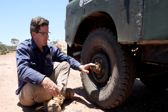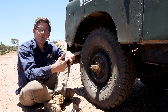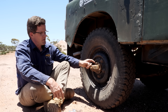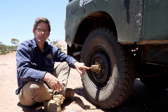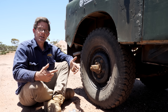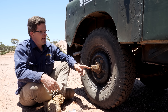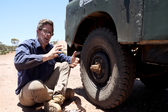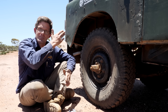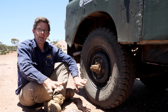So it allows that. Now, in the end of the Salisbury axle, there's actually been a hole drilled into it and there's a thread. This thread allows this bolt to screw into it. And in here — a bit further in — is a large compression spring. Basically what this bolt does is pull the axle out of the diff centre, essentially disengaging it. When we want to engage it, which I'll do in a minute, we take this bolt out, we put a bung in so we don't lose all the oil out of the axle assembly. Then we drive forward ever so slowly, the splines within the axle and the differential line up, and we hear an almighty fa-tung as the axle shoots in — and it's locked.